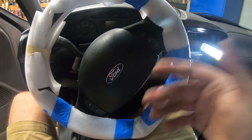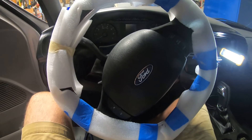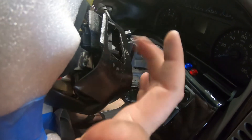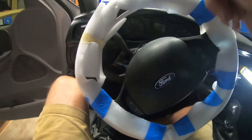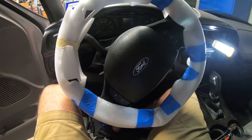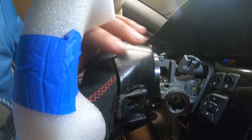Not only did I have the wrong screw on the airbag side, but it also occurred to me that I could turn the steering wheel — I originally thought about this for putting the column back cover on but never thought about it for the actual paddle installation. Rotating the wheel just gives me more room to work up here away from the ignition. This side is now completely bolted in, so I'll spin the steering wheel and swap the airbag screw on the other side.